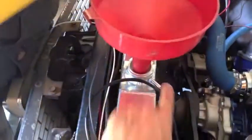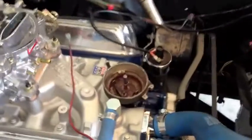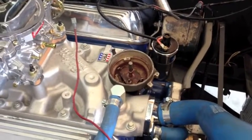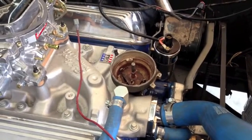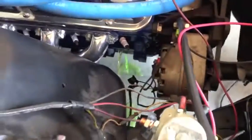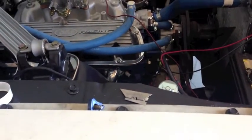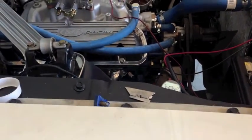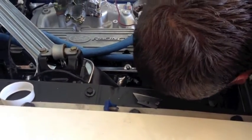We need to get an overflow, and we are about to do pre-oiling of this 289. We've got an old distributor in there. We've taken the gear out of the cam gear. The cam's not getting turned because we would never be able to turn it. We got a leak — whoa. Why is there no pipe plug in there? No core plug, no pipe plug.